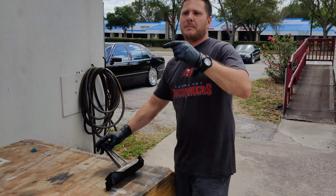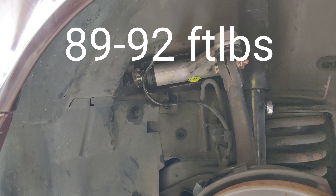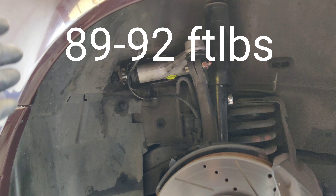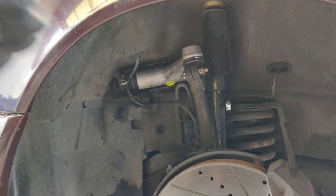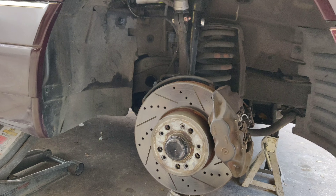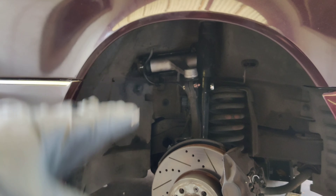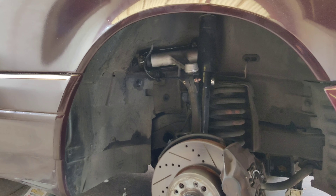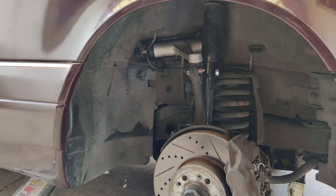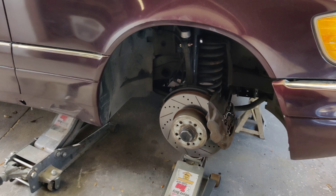She's torqued up to 125 newton meters — I've also seen 120 newton meters referenced, not a big difference, it just needs to be really tight. You want it jacked up so you can set the spring load to the proper pitch. After you've got that, slowly let down the jack and it should set into place. That's going to allow the proper height when hitting bumps so it bounces back to the proper position. You'll definitely want to get an alignment after doing all this since new suspension parts can throw off alignment and cause uneven tire wear.